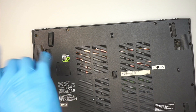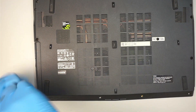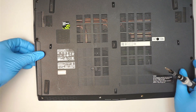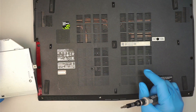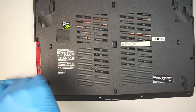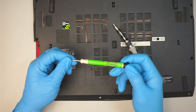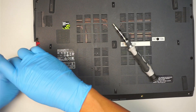I'm getting there — just remove all the screws. There are a lot of screws here, so let's go ahead and remove them all. Once I've removed all the screws, the next step is to go ahead and slide the optical drive. Slide it to your left to remove it, because there are three hidden screws here. These three hidden screws are a lot smaller, so I'll be using the 1.5 Phillips screwdriver. Go ahead and remove those three hidden screws.